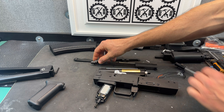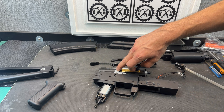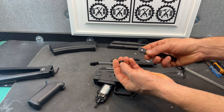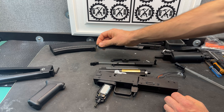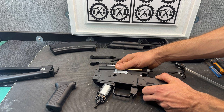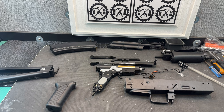You've got a pin right here you're going to need to push out — that's going through holding the gearbox in. This is where the shot selector goes; you can see right here is where the shot selector attaches. I try to just put things back in place so that I don't lose them. This top piece pops off of the selector, and then you need to unscrew this — that screw is what actually goes into there. The bottom of your grip has a screw; you just unscrew it and this comes off very easily. Now the whole gearbox can slide out. I was told that on some AK-style blasters you may need to remove the cage, but on this one we didn't. This has what's been described to me as like a V3 with a motor cage.